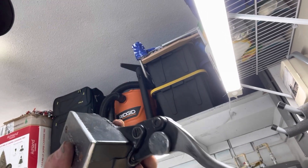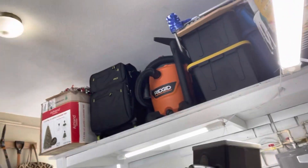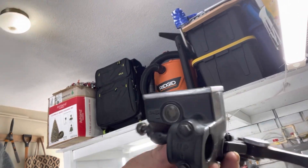This is what came off of it — this is a Nissin, N-I-S-S-I-N. If you look up here you can pretty much adjust that, and it also has a much larger reservoir. But I want to go with newer technology — put a better brake master cylinder up here. It's still axial, not radial, but I believe it's going to be better than what I had to deal with on this one.